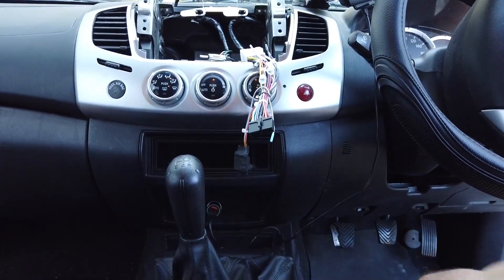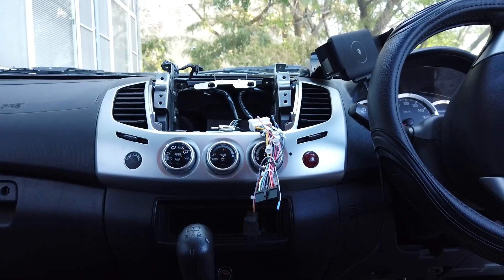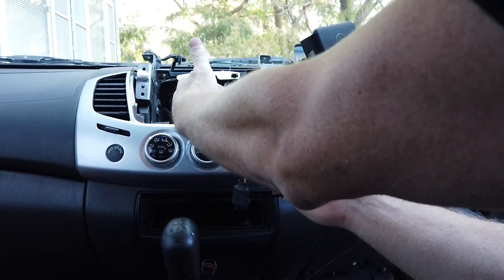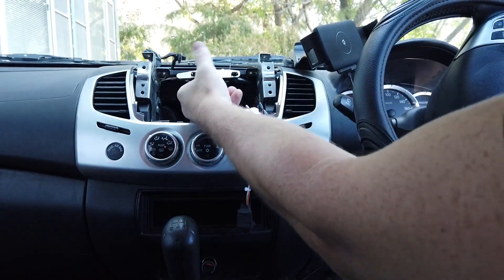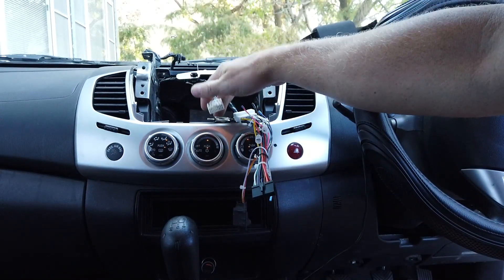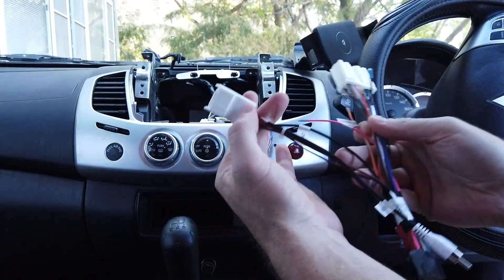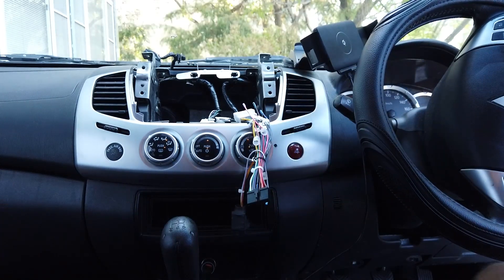You just need to find the cable kit that matches your car. We should have a 20-pin one in there — this one here will do your steering wheel controls. Don't worry, it will be in your kit. Normally you'd have a connector like this — just plug it in like so. Now we've hooked it in and tested it.